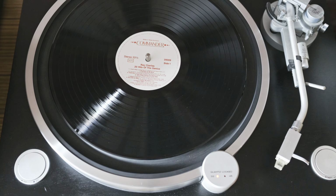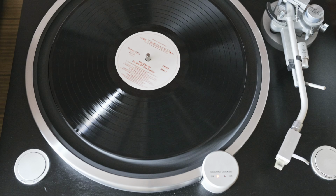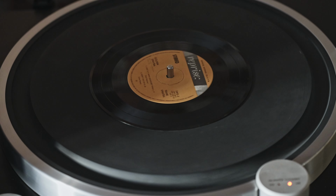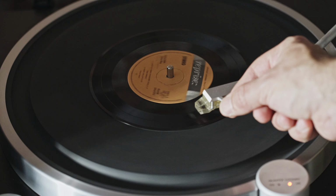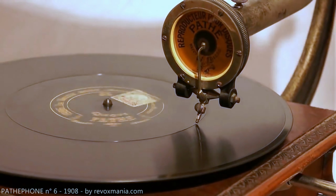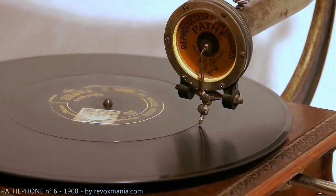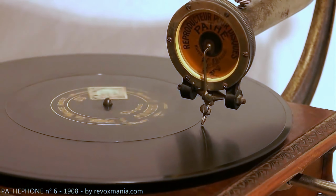That being said, there are three speeds you can come across when using a turntable. 33 RPM, 45 RPM and 78 RPM. 33 is a standard for 12-inch LPs. You can find some LPs that need 45 RPM, but the most common speed is 33. 45 RPM is usually for 7-inch discs. Again, you can find some 7-inch records that need 33 RPM. And finally, 78 RPM is used for old 10-inch discs, also called shellac records. They are not produced anymore, and thus most turntables feature only 33 or 45 RPM speed. Also, shellac records have a much bigger groove and you need a different cartridge for that.